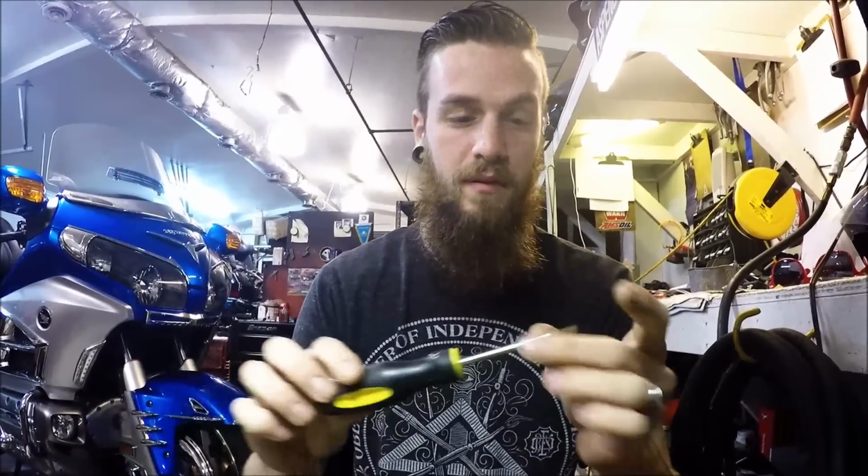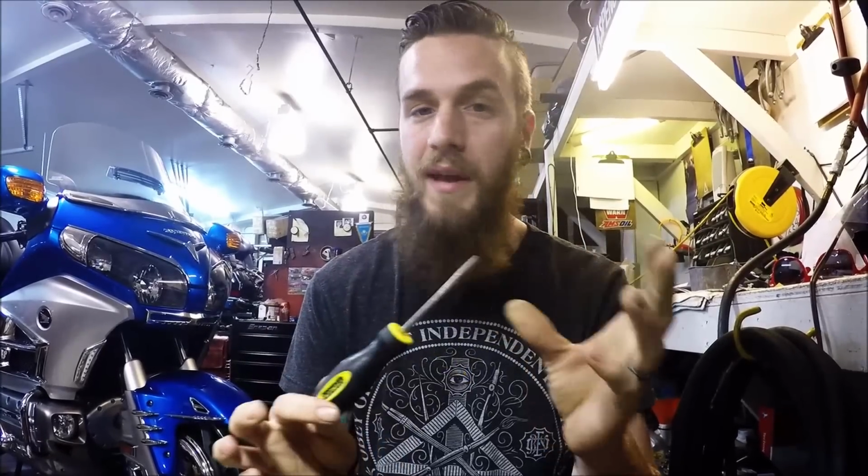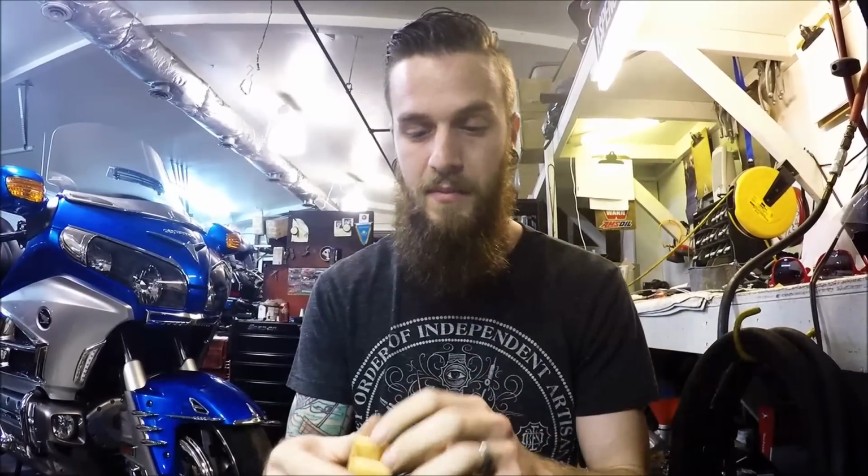You will find out that every bike has a float level spec, what it should be at, the height, the level, all that stuff. Every bike that has a carburetor will have one. I don't care what brand it is. You'll also need a small flathead screwdriver or whatever you want to use to make your adjustment on the tang of the float. A float can look like many different things, but this is usually the most common.